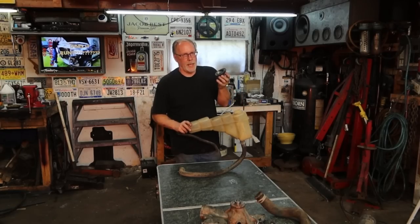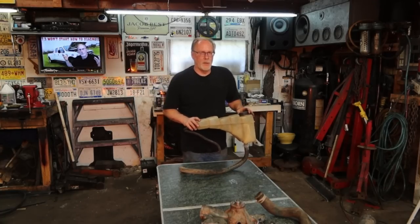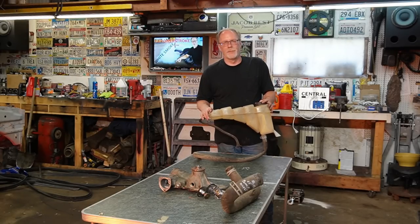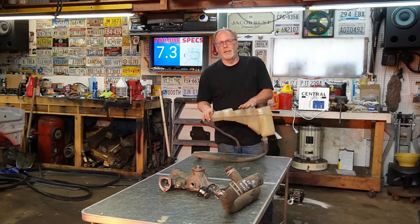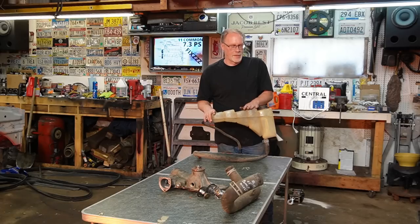Always make sure that your cap is in working shape and is not loose, has not failed, and if you need a new one, this is something that is Ford OEM only. God, I can't tell you how many aftermarkets fail, one after another. And you don't want the engine temperature getting to the point where it starts boiling off the antifreeze and getting gooked up.